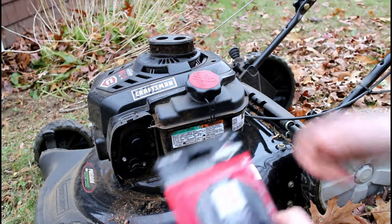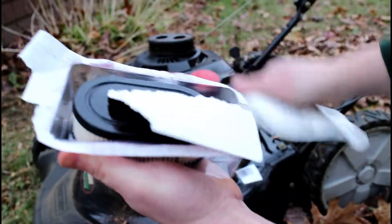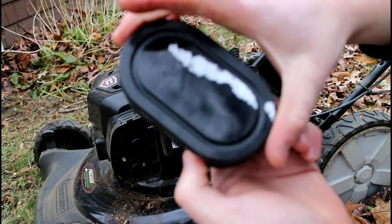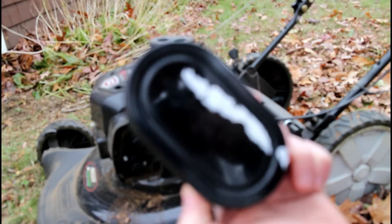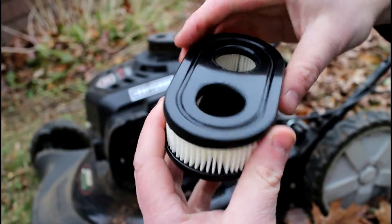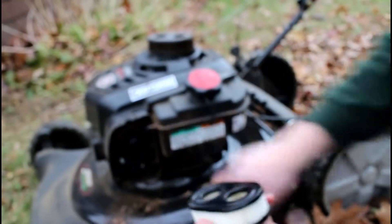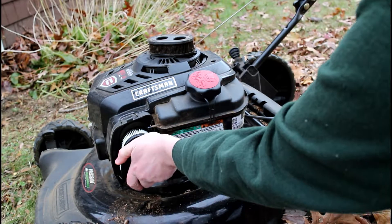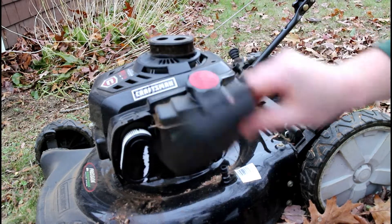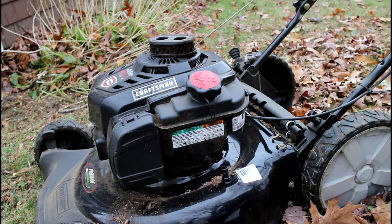Let's put that aside and go ahead and open the packaging for the new air filter. You'll see that it's the same shape and size as the original air filter, but obviously a lot cleaner. You can see this is going to work — it's got the two holes which on the air filter box will just slide right in. Then the only thing left is to take your cover, make sure you latch it right back on, and it'll just pop right back into place.